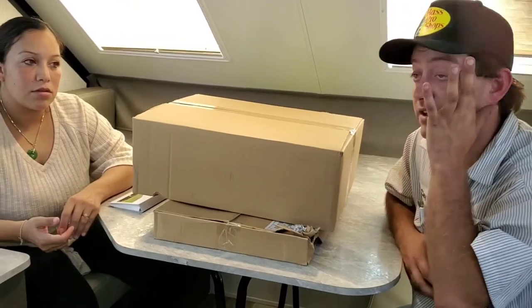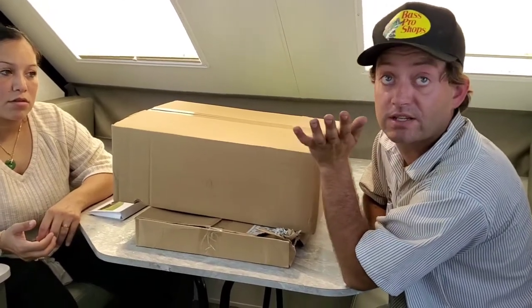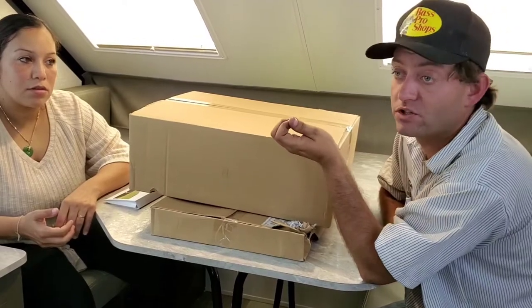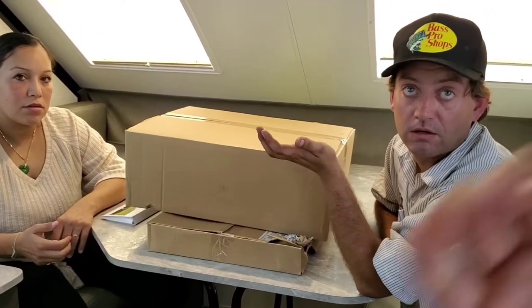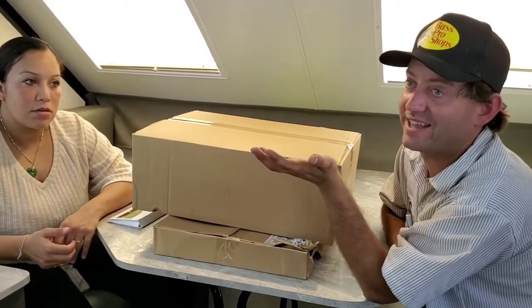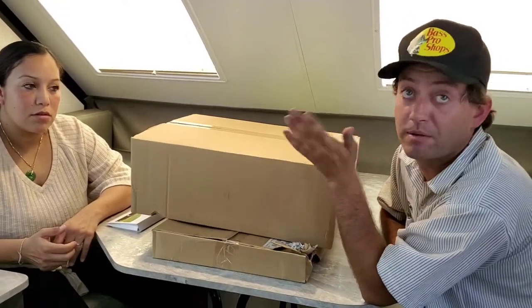So what that does is, the 7-way on the trailer is just powering the lights, your running lights, turn signals, brake lights, all that stuff, and the brakes. But as of right now, if you don't have a brake control, all it's doing is the running lights. So it's just going to roll, basically. Your car will stop it, it's not a big trailer. But starting from the time you don't have brake control, you're towing this thing, you're going to put wear and tear on your car.